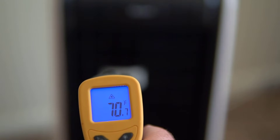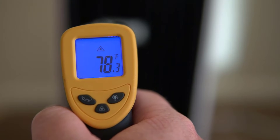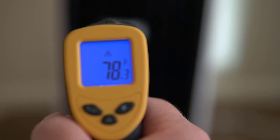So the next thing I did was put the hot water in, and the temperature was 78 degrees compared to 82 degrees which was just the standing temperature inside the house at that time. So even when I was putting in really hot water the evaporative cooler was still putting out a temperature that was 4 degrees cooler than the room temperature. Overall there was an 8 degree difference from the temperature with ice water versus the temperature with hot water. An 8 degree difference actually is quite significant, but it's not nearly as significant when you think about the nearly 60 degree difference in water temperature.